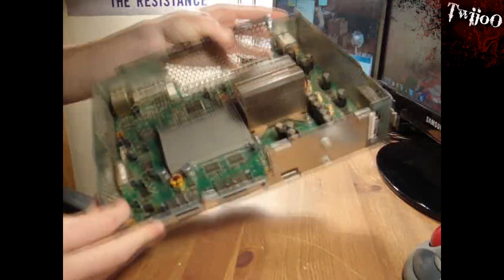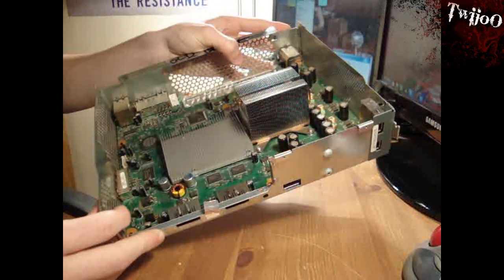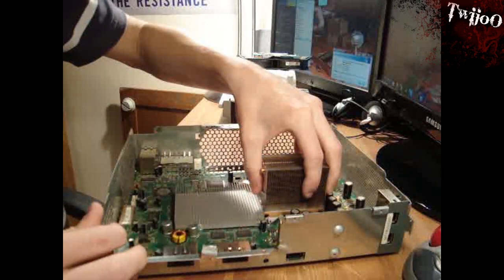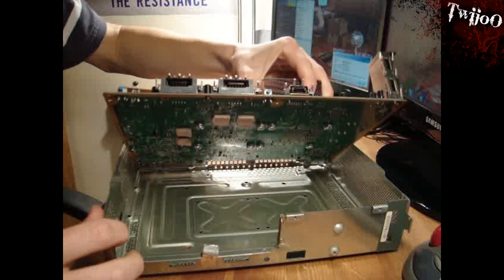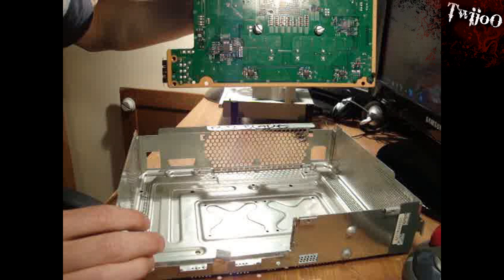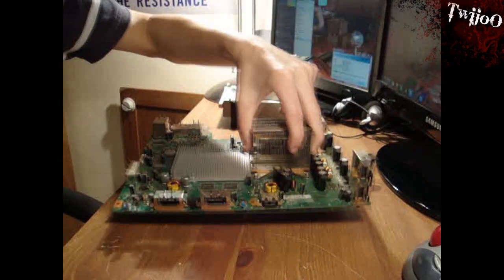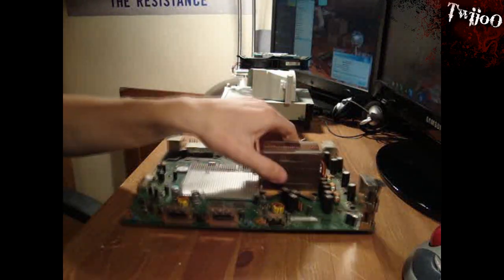And that's just your motherboard and your case. Grab it by the heat sink usually, pull it out at an angle, and it should — if you haven't got anything clipped in — lift straight out. How easy was that? Lovely job. Put the case on the floor. There you go, you've got your motherboard out.